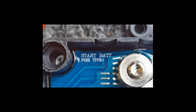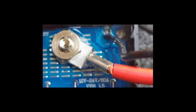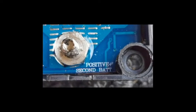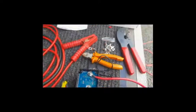If you zoom in there — that's your start battery positive and that's what I've linked that to. The next one will be the positive for the second battery, which is the internal battery behind my driver's seat. I'm going to run the positive to that — I've got spare cable from when I did the original build.